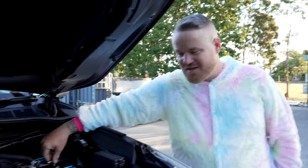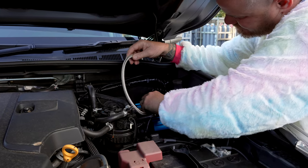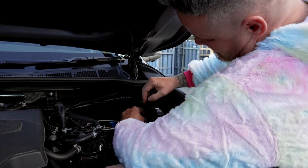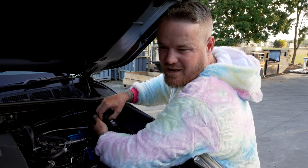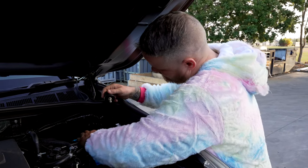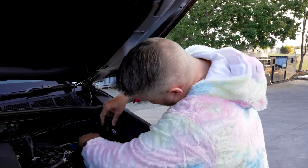One bit I've left out - this 90 degree fitting screws into there. There's a fitting on the bottom of this, and you screw this bad boy on. This is all from ARB - it's probably going to cost you about 60 to 70 bucks in parts. However you want to plumb it, you can go straight underneath here onto this, or you can put a 90 degree off here and just have it plumb in like that - depends on how you want to plumb it. A couple of different options. Feed this bad boy up through the hole and screw it on there. There's one nicely plumbed up.